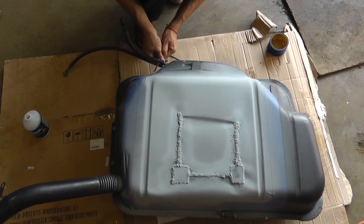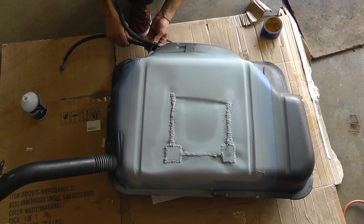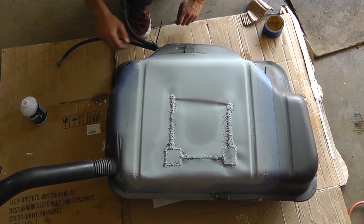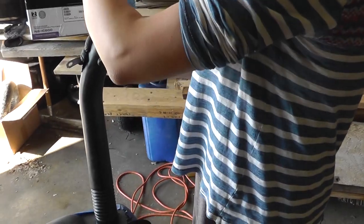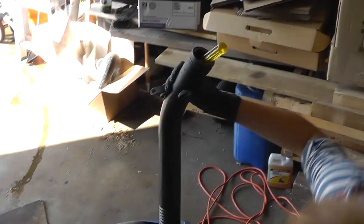As for the conditioners, I think the 8 ounces of B conditioner, which is pretty much acetone, is plenty, and same for the acid. Etching acid, here we go, removes rust and etches metal. So what you're gonna need in order to etch the tank is 2 gloves of different colors and protective eyewear and probably some kind of respirator or something, but I'm not gonna do that one, but you should. Mechanical Pete is making sure that all the openings in the tank are sealed, except for the one we're gonna pour the acid through. This will keep the flap open.